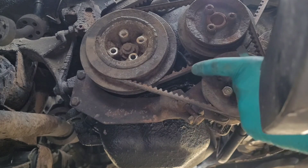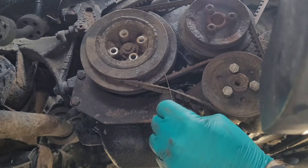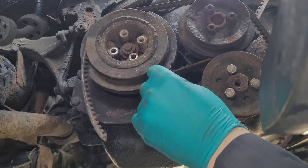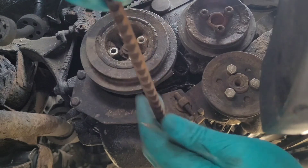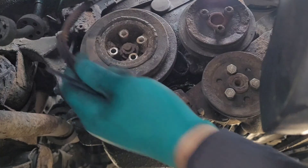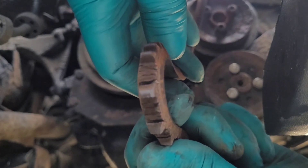I'm going to cut these off because they're knackered anyway, as you'll soon see - they're cracked. When I pull the aux belts off you can see they've sat for so long they've held their own position instead of remaining floppy. If you do a reverse bend on it, you can see that split - that's well past it. And that's the good one; this is the bad one. The state of that.